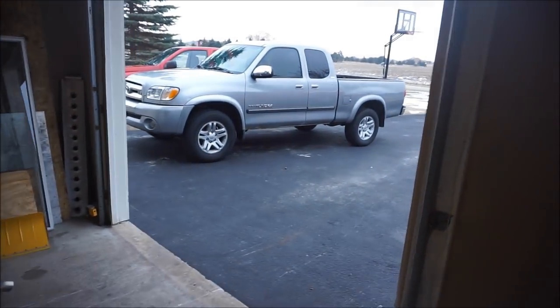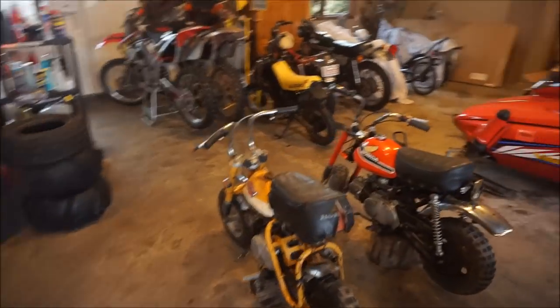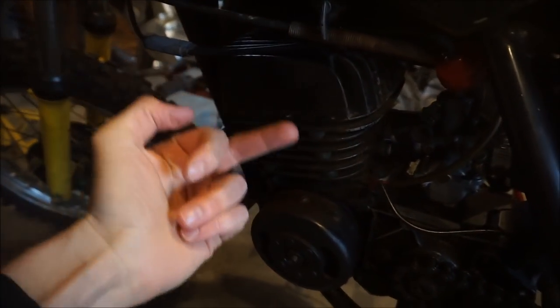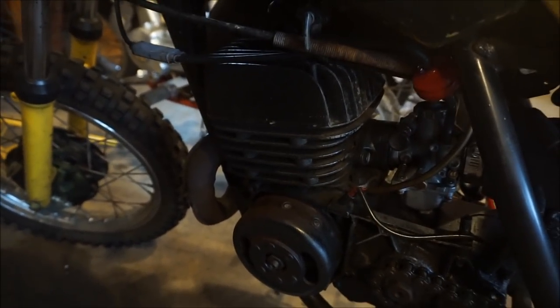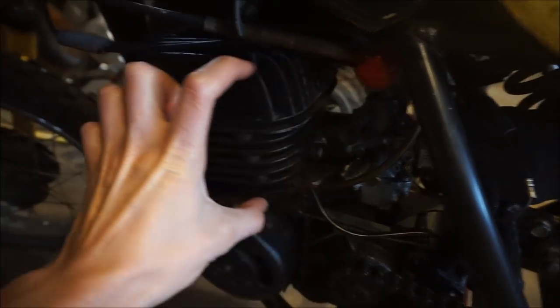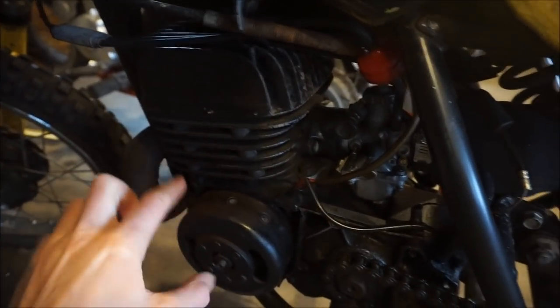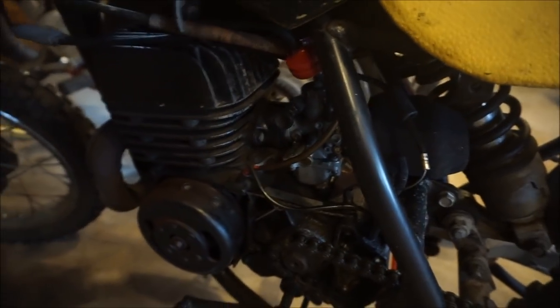As you get more experience with motors, two strokes are the easiest to work on. Take this DS80 here as a good example. You've got the head, the cylinder, and the piston. There is no cam chain, no valves — nothing. You just have to worry about the carb, cylinder, head, and piston. That's pretty much it. And obviously the points if it's an older bike. As long as it has compression — to test compression easily if you don't have a compression tester, just get a feel for it. A 50cc is obviously going to be easier to push down than a 250cc bike, but if there's some resistance there, it's got compression and it's going to start.